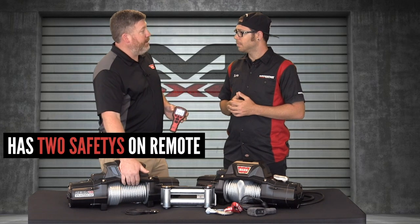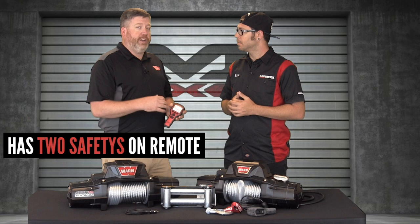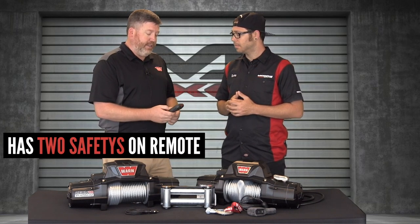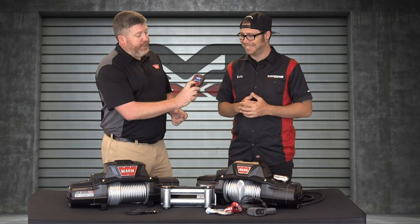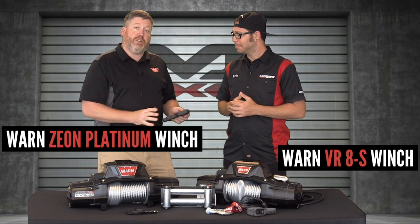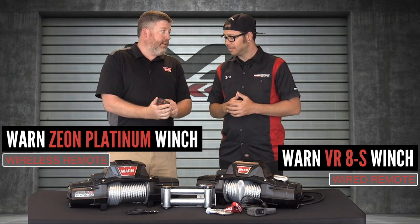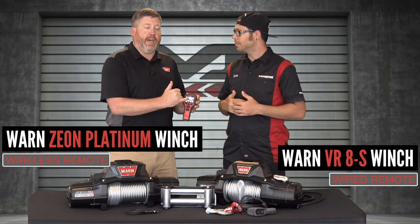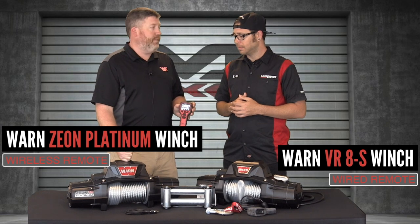I evidently have my hook and my fairlead pulled in too tight. If it has over 200 pounds of pressure on the fairlead, you cannot pull the cable out — it will not release the gears. So for this instance, I'm going to have to hit the power out button a couple times, hopefully powering out in the parking lot, and then hit the free spool button again. We lost signal — we're a little bit too far away from the Jeep. But you can see here we're picking up the Jeep battery reading and also the temperature of the winch on the remote.